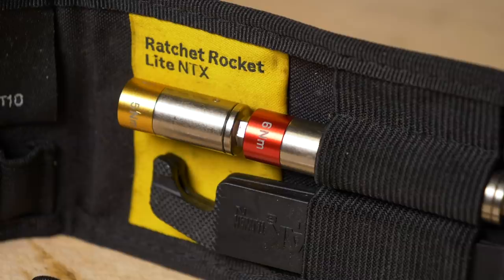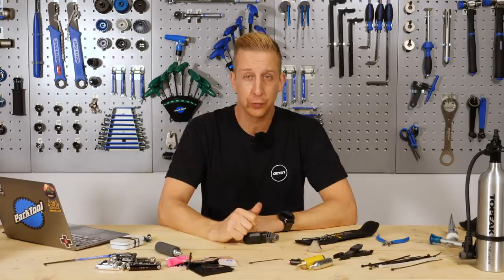There are 14 extremely useful tools for working on your bike. My personal favorite is a digital tire gauge — I've messed around with tire pressure for years and I'm quite finicky about it. Right now I'm running 23 PSI on the front and 26 on the rear. Being able to fine-tune tire pressure is a really beneficial and fun thing. Let us know what your favorite is in the comments, and we'll see you in the next video.